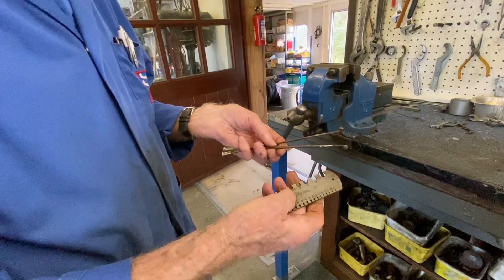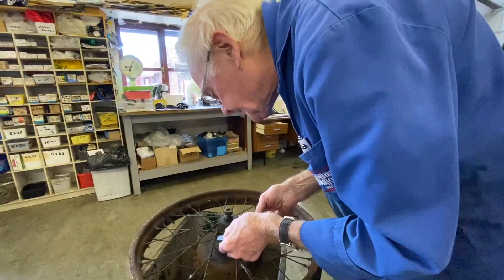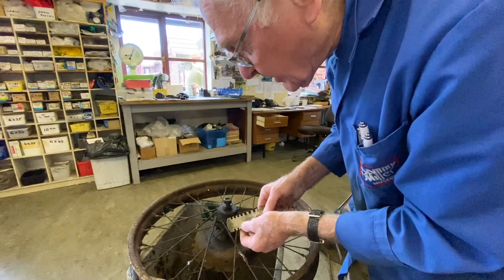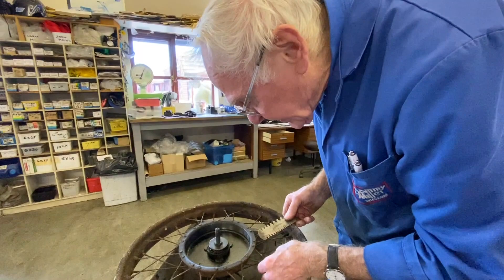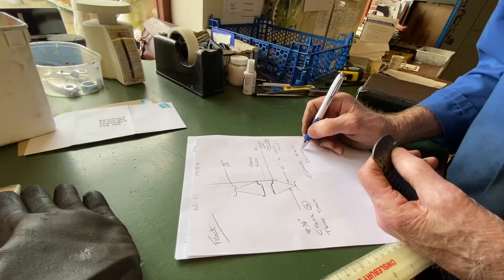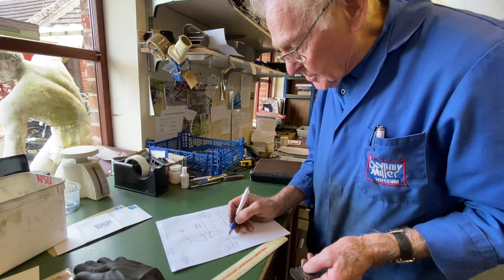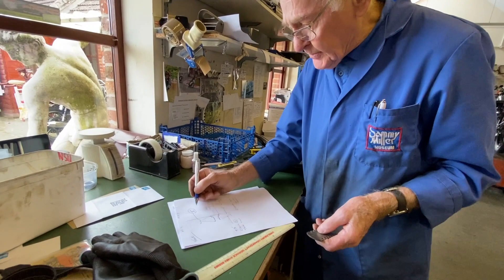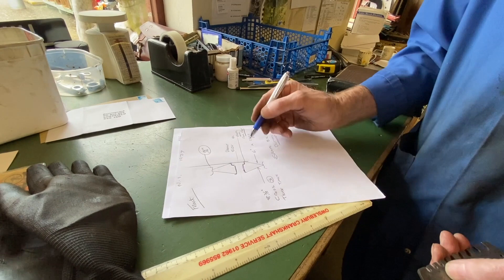That's a spoke gauge which tells you the width of the spoke — number eight. But you'll find with these ones here they're eight-ten butted — are you with me? You've got eight gauge on that side, then it swages down and the main spoke is ten gauge. These ones here look far too light for me; I feel they're not correct and I'm not going to put such light spokes in — I'm going to stick to eight-ten. So we've got the length of those, the gauge of the spokes, the number of crosses, and the offset, which is 15/16 inch on the brake side. We've got the flanges noted, the length of both spokes, the number of crosses, and the size of spokes — so that's the front wheel done.